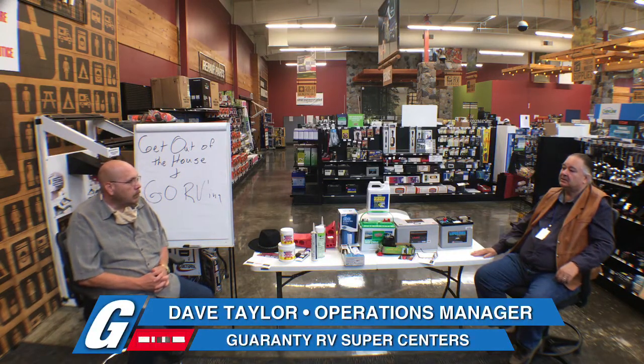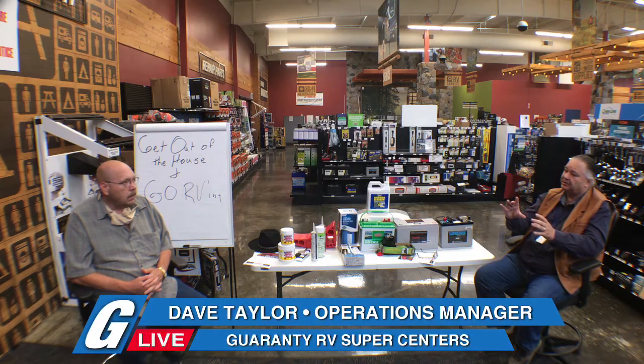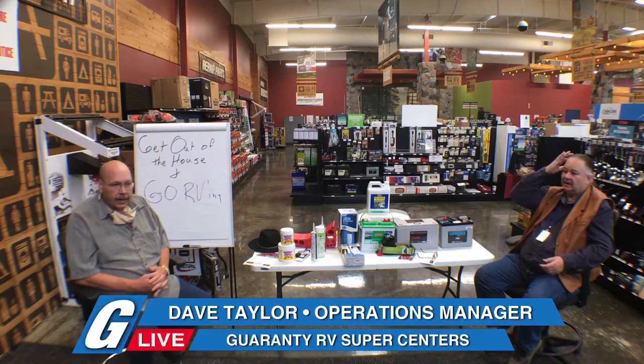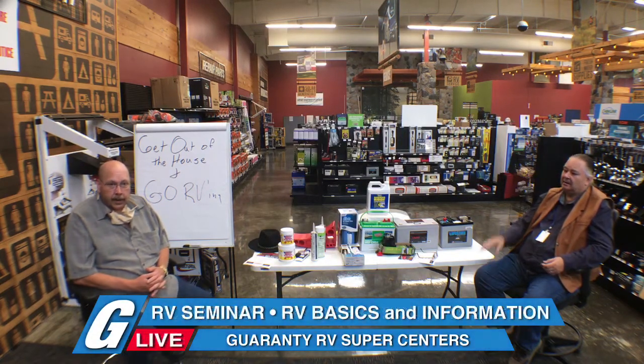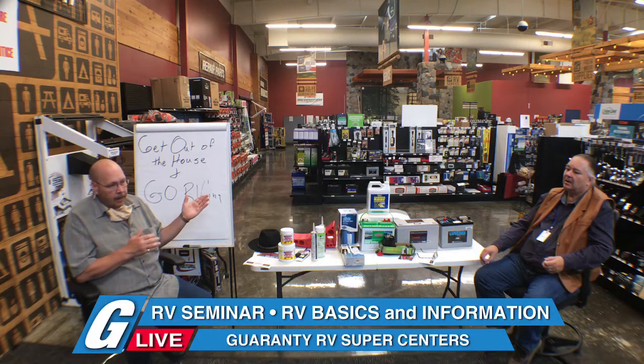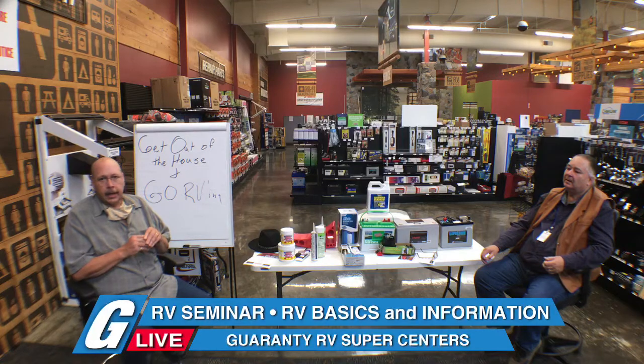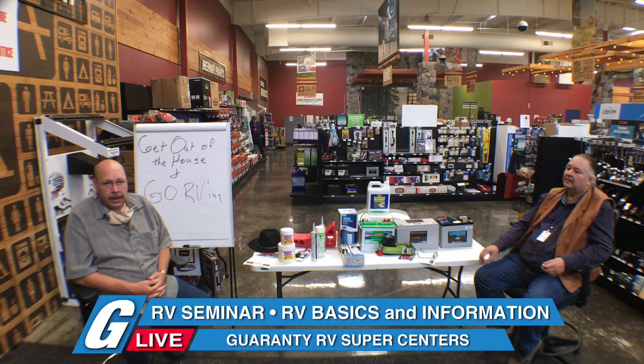They do have a kit if you're going to charge while driving — it's a diode pack and converter system that goes between the alternator and the batteries. Basically, it stops any voltage going the wrong direction and causing damage to your charging system or alternator. If somebody just says 'bring it by our shop and we'll put those in,' you may want to talk to somebody who actually does lithium installs and knows how it's to be done the proper way.